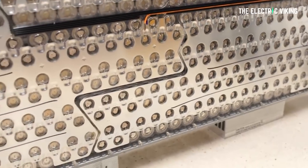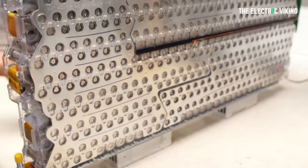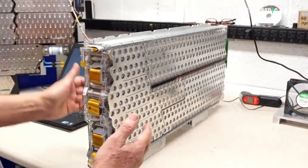There were 16 total modules in the original Tesla Model S pack with 7,104 cells. That means one module had 444 cells, all cooled by one single ribbon-shaped cooling tube that snaked its way through the module. That's a lot of cells to cool in one pass from one tube — no wonder the original packs were overheating.